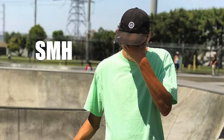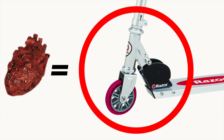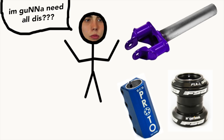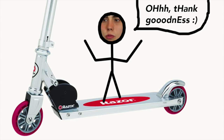With the invention of the threadless fork came headaches as well. Every single scooter fork around this time came with a threaded fork and matching compression, so completely changing the central heart of the scooter didn't always go well. To ride a new threadless fork, you'd need a new clamp, a new headset, and obviously a new fork. If you bought a scooter from Walmart for $90, you'd need to spend about another $200 to make it safe. Fortunately, by 2018 basically every complete scooter comes with a threadless fork and matching parts.